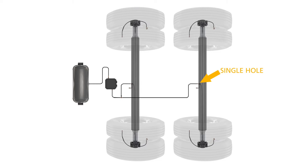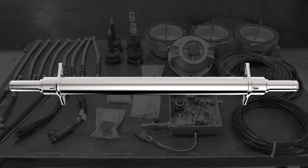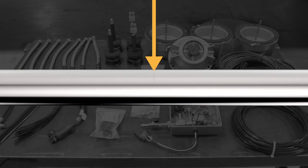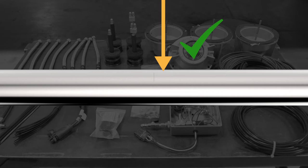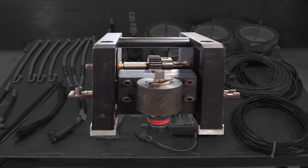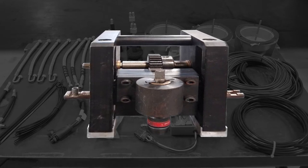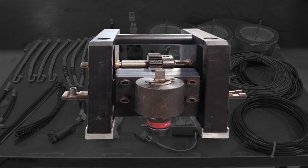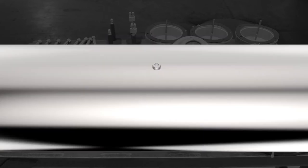The Tire Pilot Plus features a single hole axle tube installation. Next, you must drill a centrally located hole in the top of each axle tube. If your axle features a pre-drilled hole and plug, these steps will not be necessary. The location of the hole should be near the center of the axle; however, if your axle has a center mark indicator, do not drill directly on the center mark, as this is used when aligning the axles. Instead, choose a spot off to one side. Place the SAF Holland drilling fixture onto the top of the axle, clamp down tightly with the included chain and vise grip, and ensure the fixture is level so the hole is drilled perpendicular to the axle. Drill a hole using a size R drill bit, then tap the hole using a ⅛-27 NPT pipe tap.